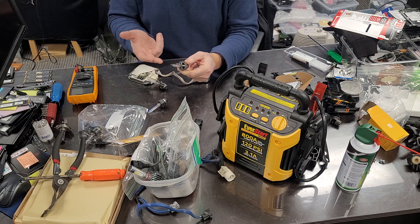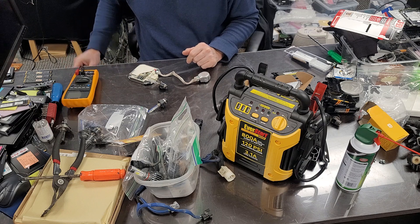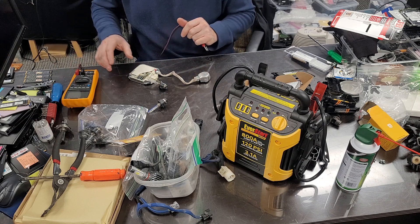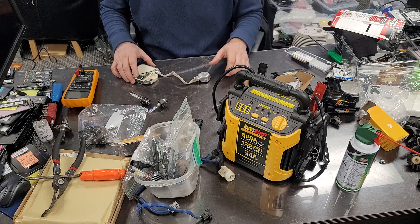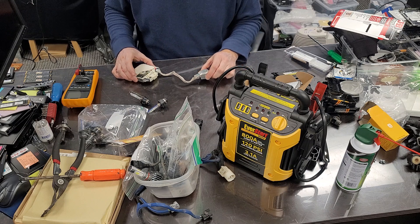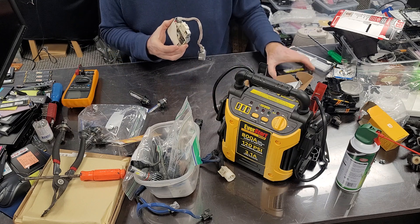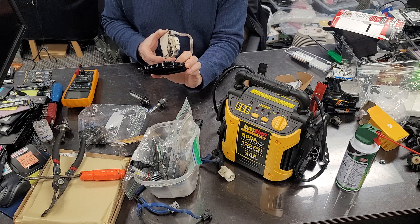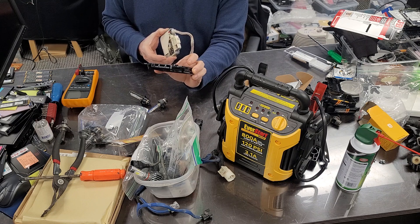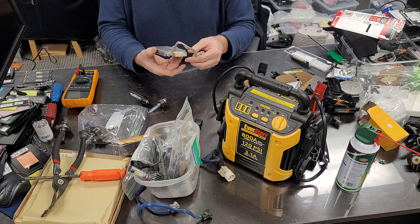So how do you test these to see if they work? I've got a system for you that's not very expensive. It comes from the headlight assembly — if you go to the junkyard like Pull-A-Part and find a car with a smashed headlight, you can find this inverter unit inside there. Mine actually comes from a Toyota, part number 8967520 21, but the part number doesn't matter.